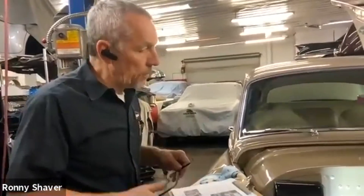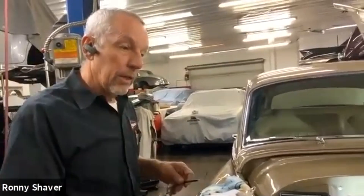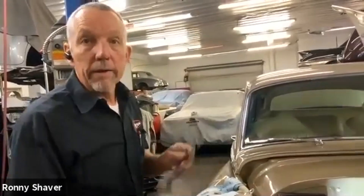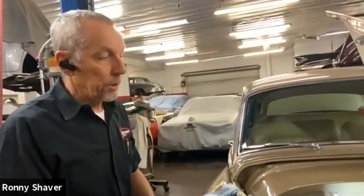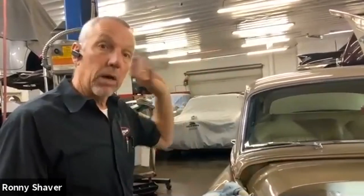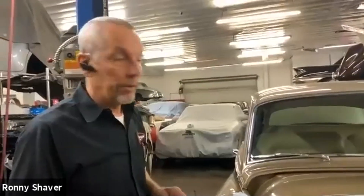I'm not sure about how much voltage — I know they will put out a lot of voltage. The faster they go, the more they'll generate. The regulator's job is to control that because we don't want to put too many volts into the battery, because then it will get too hot and overcharge it. Plus, on later modern cars, if the voltage gets too high, you're going to start damaging electronic components.